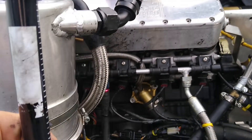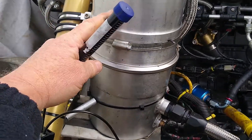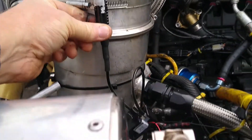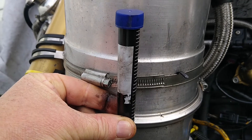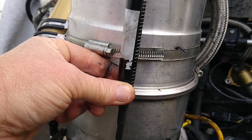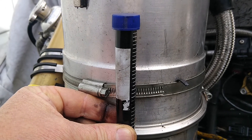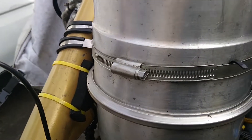The next job is working out the best place to mount the reservoir. On my car I've got a dry sump, so there's this big oil tank here which seemed a really easy place — it would be absolutely ideal because it's virtually directly above the chain. The trouble is that oil tank, when you're running the engine, the oil gets hot — up to around 100 degrees. I think that's going to really affect the viscosity of the oil in the tube, which is obviously going to affect the rate it drips down. So I'm trying to think of somewhere to mount it where the temperature is going to be a bit more stable.